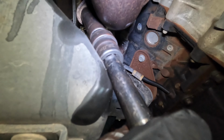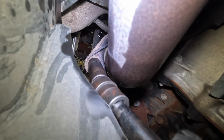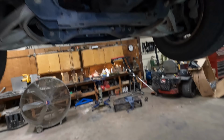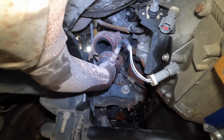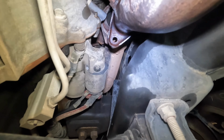Oh, sorry if you can't see, but neither can I. Oh, there, it's on. Alright. So, if you have problems, just soak them, and then if they still don't come loose, start heating them. Okay guys, see that? We got it loose, and we got that side loose.